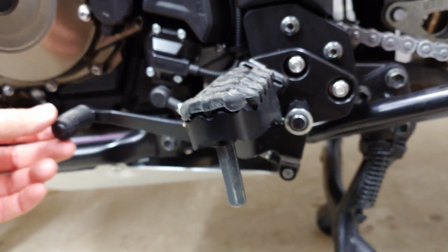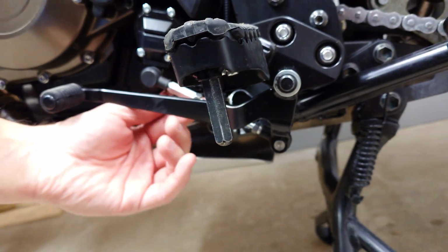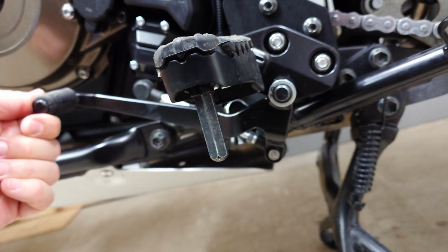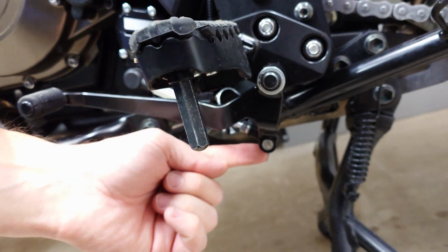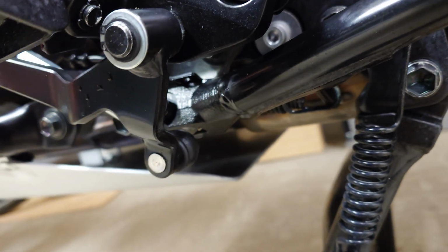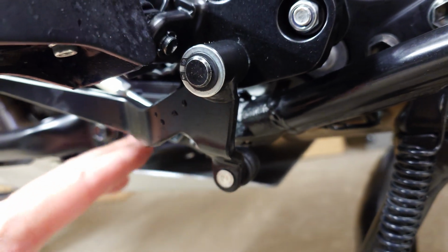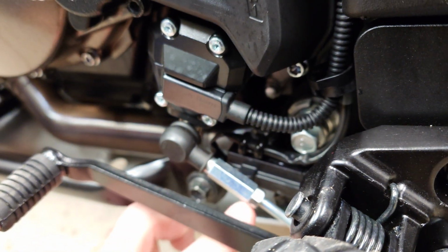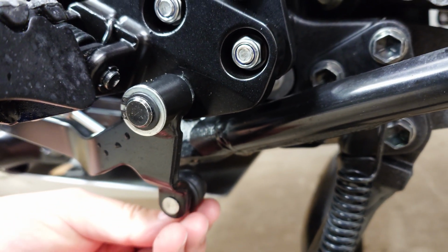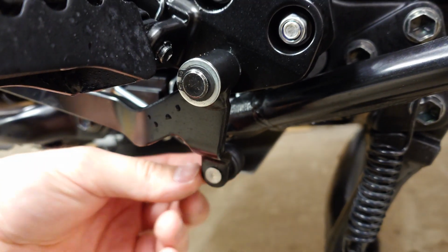So when you, let's see if I can focus here. Yep. So when you shorten this shaft, and this assembly or this lever will move up, you have this hinge. It's also moving a little bit forward, and because I think, again, because this adapter is a little bit too long, this hinge is a little bit too far back. Now it's also lowered by 3 centimeters.